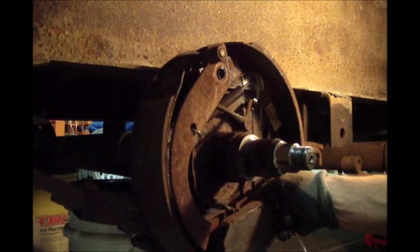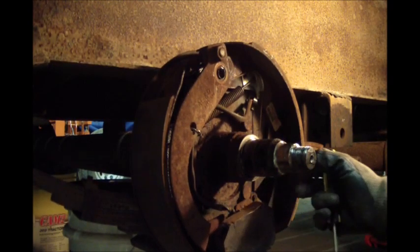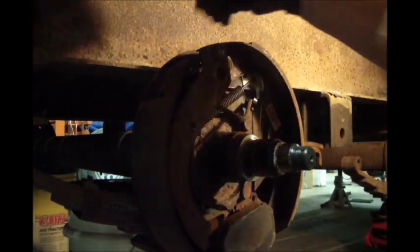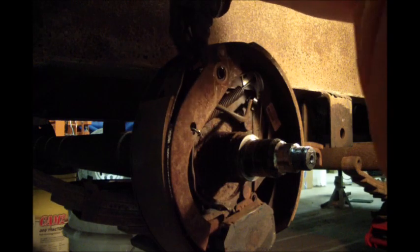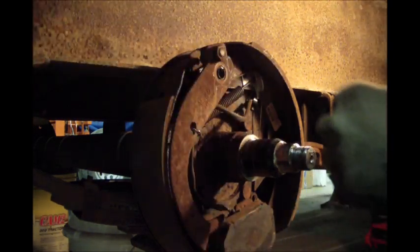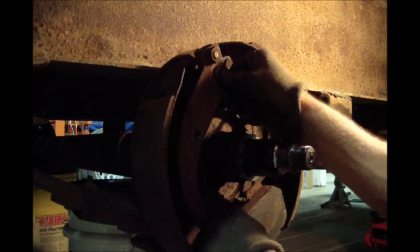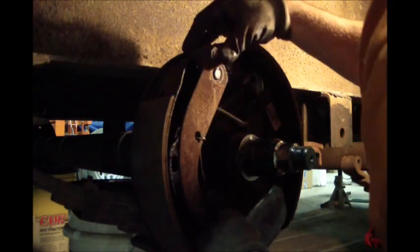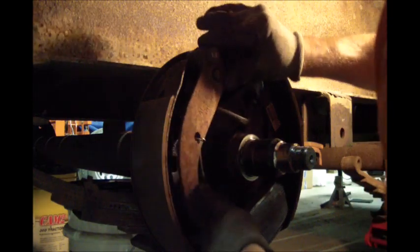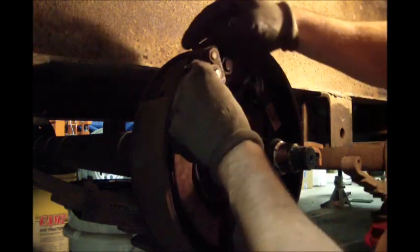That's to keep the arm from wiggling back and forth as much. And it could even stand to be a hair bigger. So put a little grease on this nut that goes here between the two pads. That actuates the pads. That shim stock is a good tight fit too. It just barely goes back in there all the way. There we go.